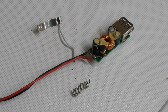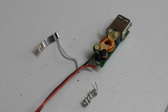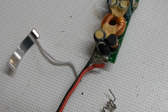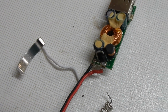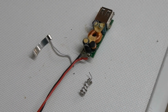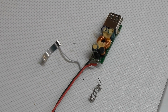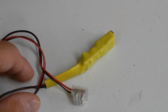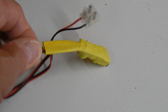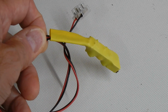Once denuded in this form, you can graft on some cables to the circuit board. They're soldered in place here at the end, and these can then be connected to your 12 volt power supply. And a few minutes work with a piece of heat shrink and a hot air stripper gun, and we have a protected version of the power supply.